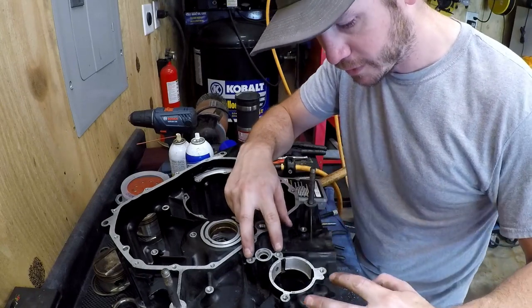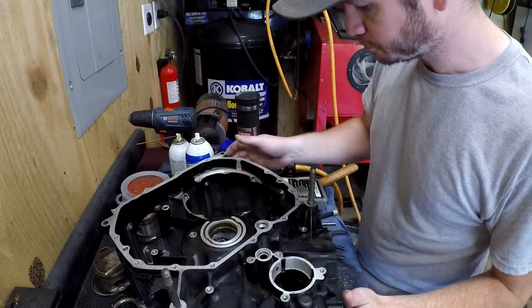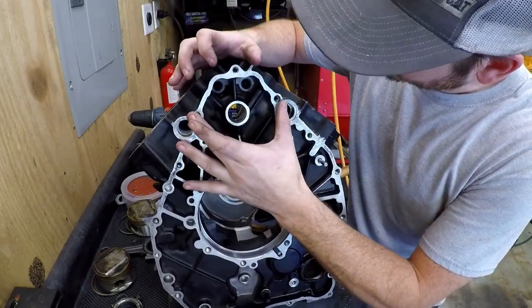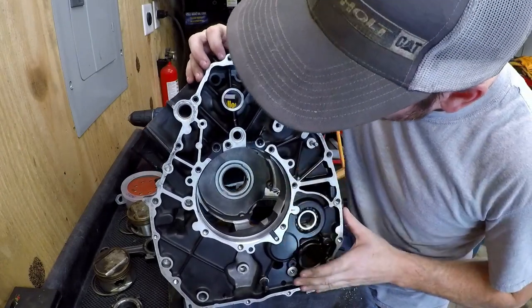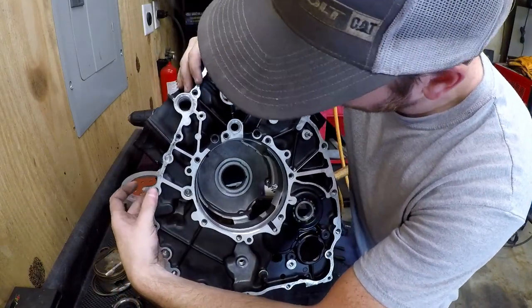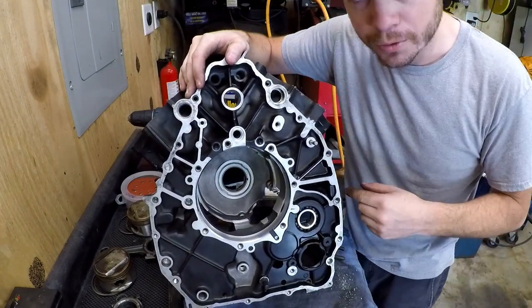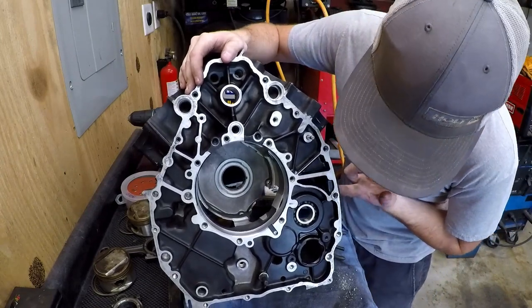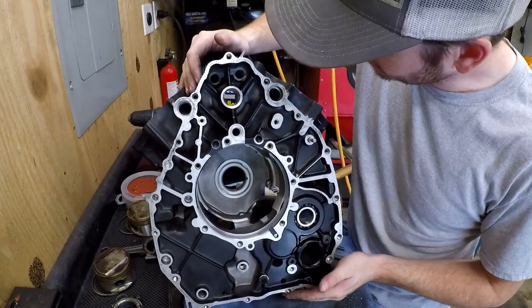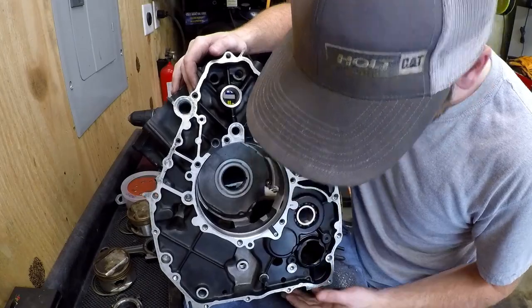But for the camshaft holder and the cylinder head jackets, I definitely had to clean those up. And then the back of the block, around my water pump, this 8mm was a little grungy. There's three holes that go all the way through, so they're exposed from the backside. This one I still have to chase, but it had some corrosion and dirt and grime in it. And then from there, the back of the block will be good. But that's just a good precaution to take.